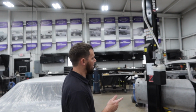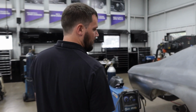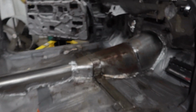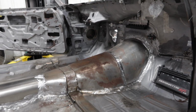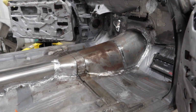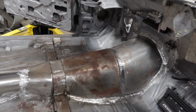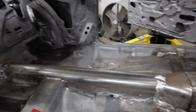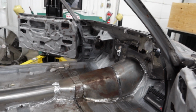So first up, Simon Chevelle. Paul's been making a bunch of progress on the floorboard sheet metal work. This car is getting a 4L80 from Bowler. Anybody that's done any of this stuff knows that basically any of your late model transmissions don't fit in the stock tunnel. So as you can see here, the tunnel's been raised, widened a little bit, and then the full length as well to gain some more driveshaft clearance, because we plan on this car being pretty low.